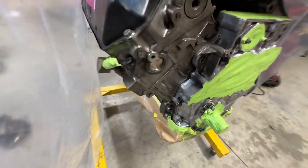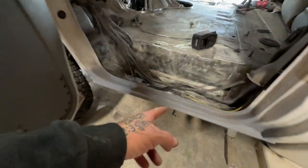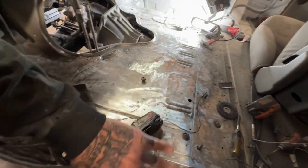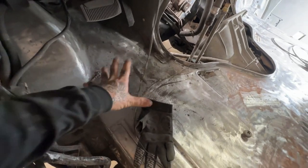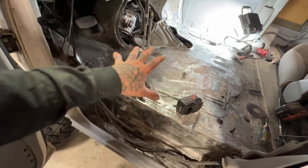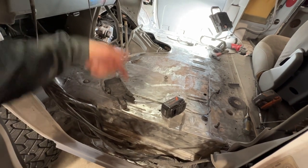The engine is all masked up, ready for paint - that's going to be happening very, very soon. I'm really happy with the progress that I've made on this ambulance. The rockers are in, floors are welded. I completely sanded down this whole floor. All it needs now is a vacuum, a full-blown paint prep wipe down, and then all this will be done in an epoxy primer, good and thick so no moisture can penetrate through and touch these floors from the top side. What causes the rotted floors is from wet boots, from snow coming in - the water drips down, gets underneath, pools there and just stays there and rots your floor. So I'm doing a super thick epoxy primer down here and then we're going to topcoat it super thick.